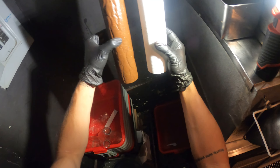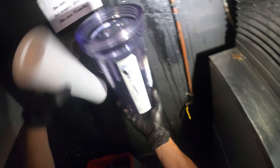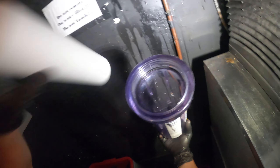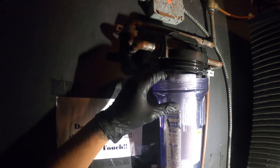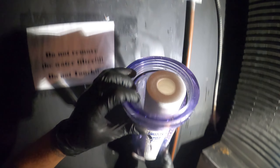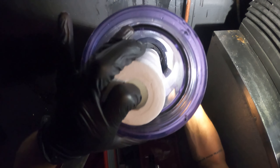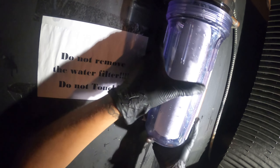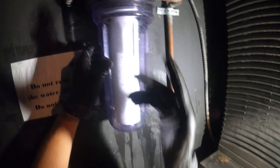Put a bucket here to catch the remaining water. There is quite a difference to this filter — I definitely recommend wearing gloves while you do this. We're going to take our new filter and if we look inside there's a little thing sticking out where you stuff it in. Make sure that lines up, and this part has a hole — get it around the enclosure well. Also this was leaking, so make sure the black gasket inside is tight. I think this was just honestly extremely loose, so let's get this in here, spin it back on, and make sure it's tight.